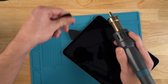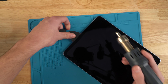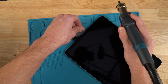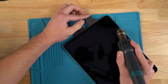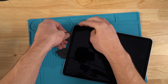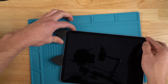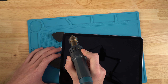When adding another spudger, just push up on the screen a little bit — not too much, just enough room for the other one to come in where you want. Got another one in. Push it through carefully, coming around the corner. I'm going to apply some more heat since I see a crack here.